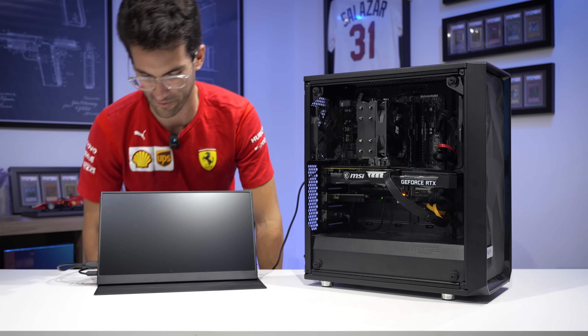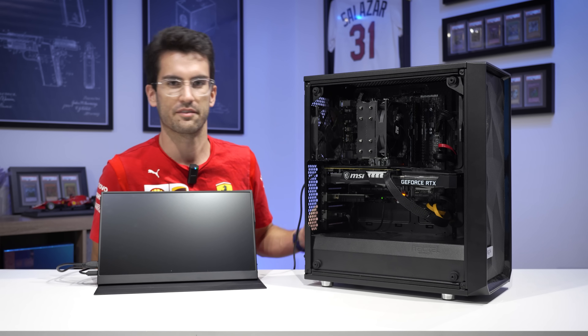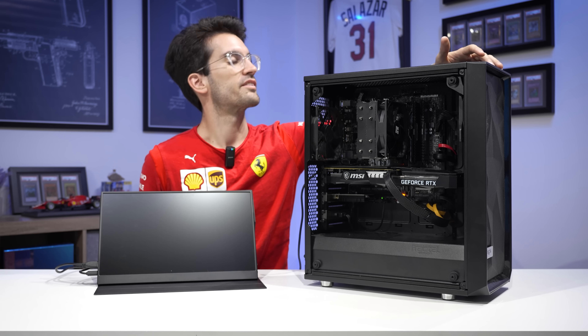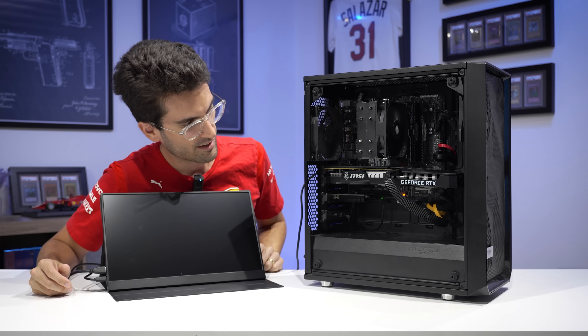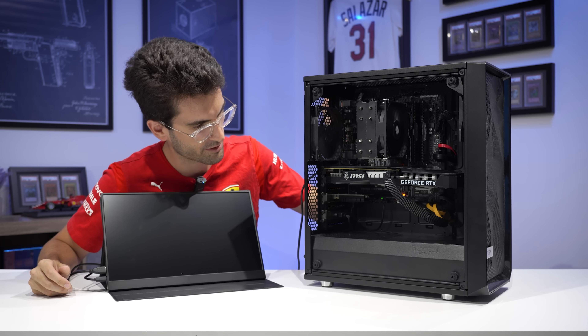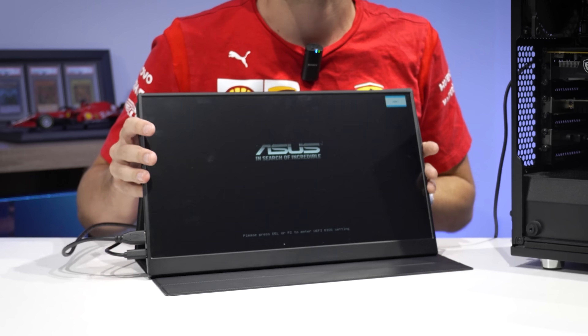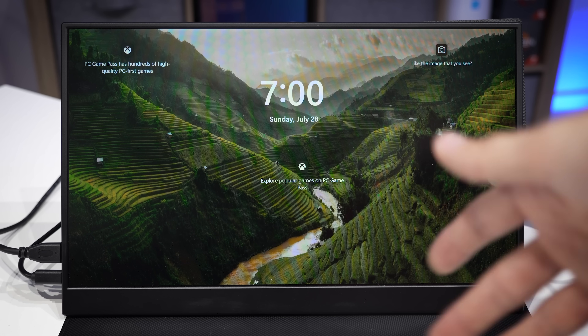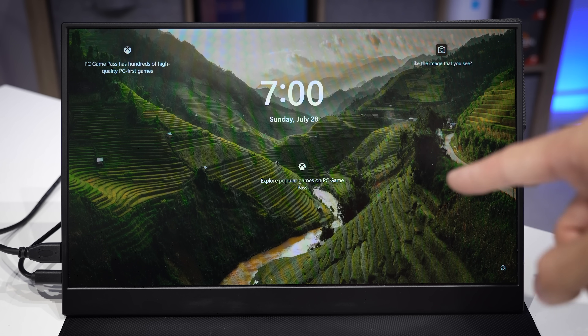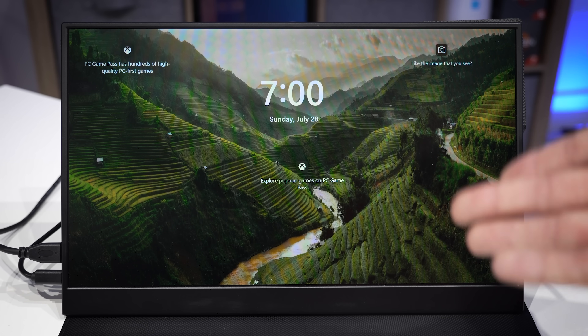The final thing to do is power the system on officially with everything reconnected. We're going to make sure not only that the system posts, but also that it loads into Windows, because I believe one of these drives has a Windows boot partition on it. I'm crossing everything I've got — it would be great to fix the system without having to put any hardware into it. Power on. All right, it turns on again — we're at least back to square one. I do hear the hard drives initializing. That's a post! We'll just grab a keyboard real quick and try to load into Windows. And would you look at that — we've loaded straight into Windows 11. That's perfect. It also loaded up very quickly, so I think the boot partition is on his only SSD. He also has two hard disk drives, though I imagine those are just for general storage and maybe games.